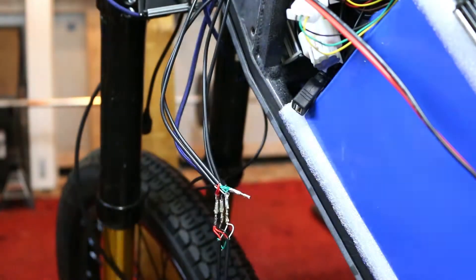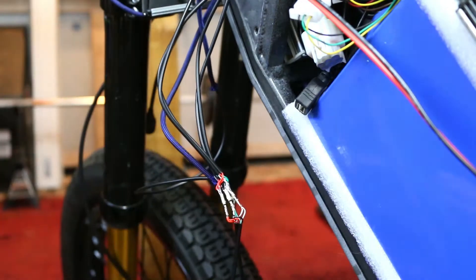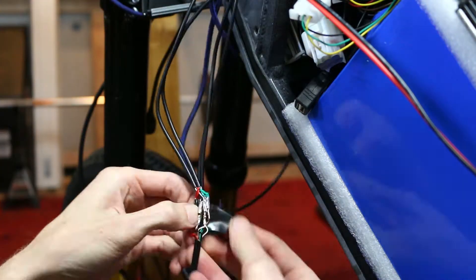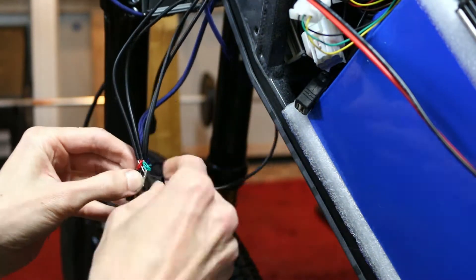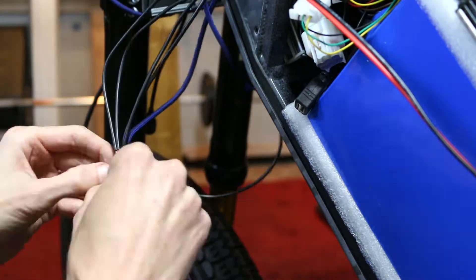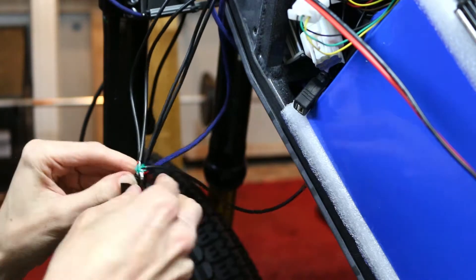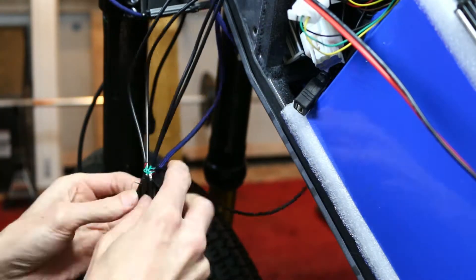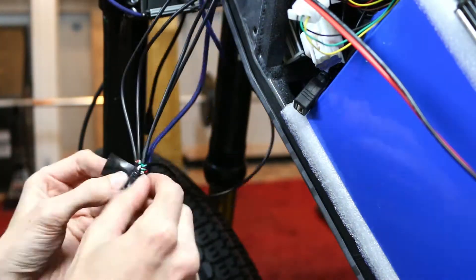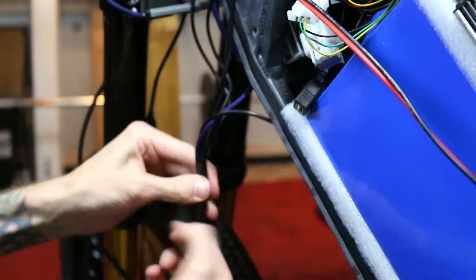I made this harder on myself by not giving myself enough leads to twist around and bundle together. I managed to get it done somewhat cleanly with the help of some pins that I crimped together. The hardest part was threading through the electrical tape as insulation — this is an easy spot for things to become short circuited very quickly. So keeping all of those individual bundles separate at this point was very important. Almost finished wrapping this part up and then we can test out the lights — hopefully they all work because I do not want to rip this apart again.